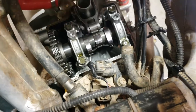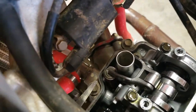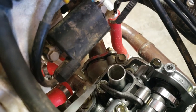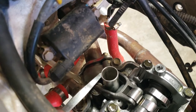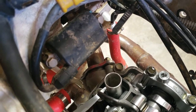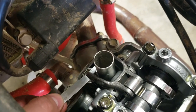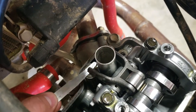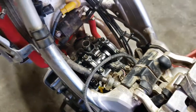On the other side, your exhaust is super easy on the Honda because of the unicam rocker design. You're just gonna go in — I'm using the same feeler gauge just as an example; you'd use a bigger one, around a 0.20, to check these. Just slide under the rocker arm and above the shim, get your measurement, and that's pretty simple.